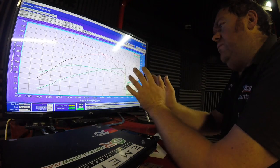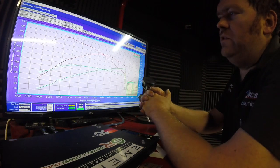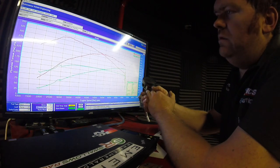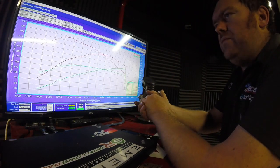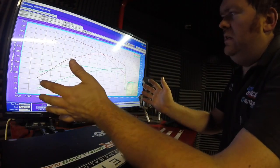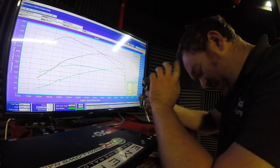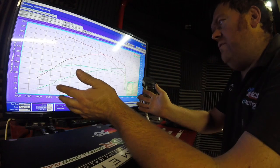I've brought this graph up. This green line is how the car used to be — this was with a 17% pulley, usual mods, GP ECU. Admittedly it didn't have a camshaft, it was a completely stock engine, and that's about what they'll make on this dyno. That was on the 380cc injector, so 206–210 horsepower is a good power. Let's say like 175 foot-pound of torque. So the red lines are now what it's presently doing at its highest boost point. We can go a little bit more, but I scaled it back very slightly because we've got a track day in a couple of days and I'm frightened we're just going to absolutely grenade it all to pieces. So you can see from the graph the actual power difference.